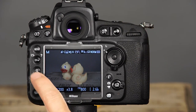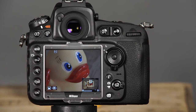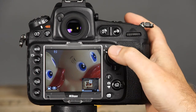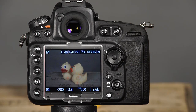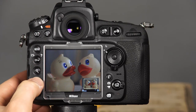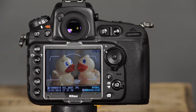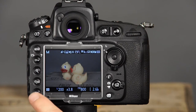This is the playback zoom in button. When you're viewing an image in playback mode, you can press this button to zoom in and see detail areas of the image. You can use the multi-selector to scroll to other areas of the frame. You can rotate the main command dial to scroll through other images at the same level of magnification. This is the playback zoom out thumbnail button. When viewing a zoomed image in playback, you can press this button once or multiple times to zoom out. In regular playback, you can press this button to see different thumbnail views. This is the OK button, which is used to confirm selections in the camera's menu system, though in most cases pressing the right side or center of the multi-selector will also confirm selections.